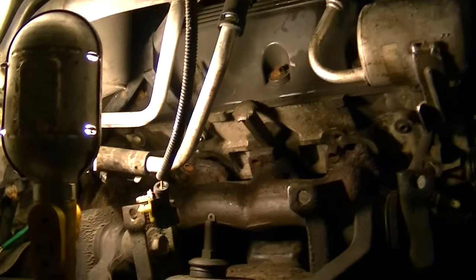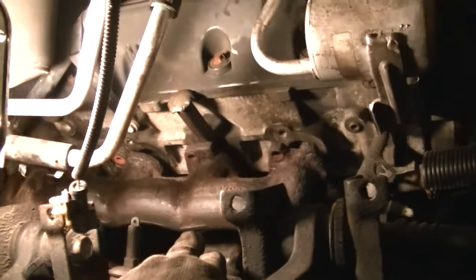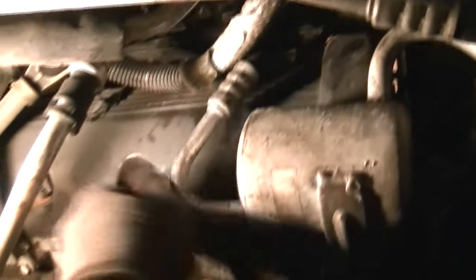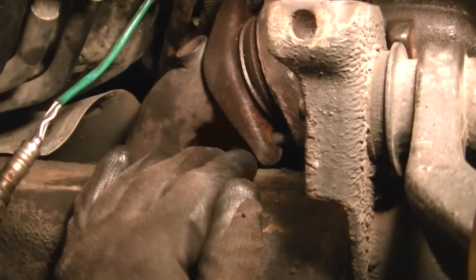Once I do that, I'll just put the oxygen sensor back in and I'll be pretty much done. There is one exception — one bolt I couldn't get on the bottom because of that motor mount. There's a bracket that bolts on the block. I did disconnect the wiring harness from the starter and pulled the starter out just to have a little extra room, and I pushed the wiring harness up out of the way. It runs right down through here and snakes down behind the manifold. There's a little nut and a bracket wrapped around that harness to keep it from hitting the manifold so it doesn't melt. That's the only fly in the ointment — you do have to take the starter off.